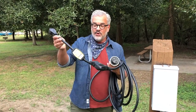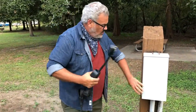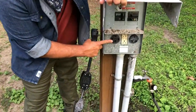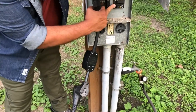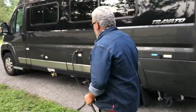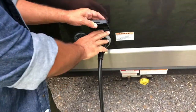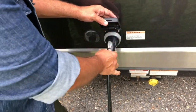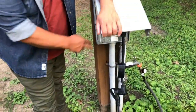Now it's time to get some power to this thing. Your power cable has a surge protector on one end and the plug for the camper on the other. Lay it on the ground, open the junction box — you have two plugs, a 50 amp and a 30 amp; you can tell because the plug matches our 30 amp. Up here is the circuit breaker — make sure it's off first, then plug it in. Come over to the camper; under the kitchen window is the plug. Go ahead and plug it in — no need to screw it in. Then go back and flip the switch: we have power to the camper.